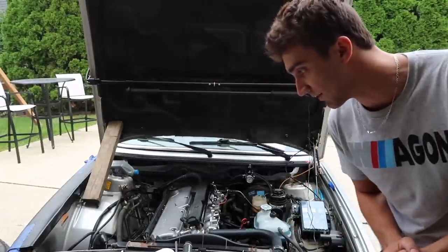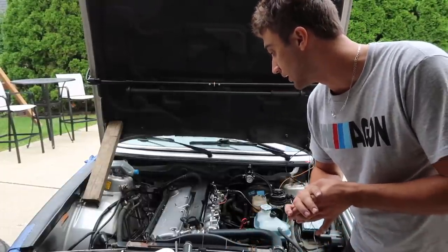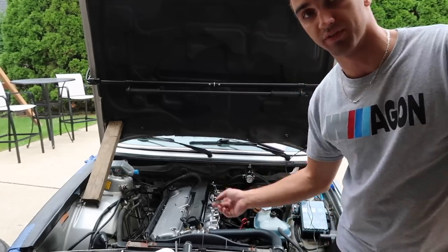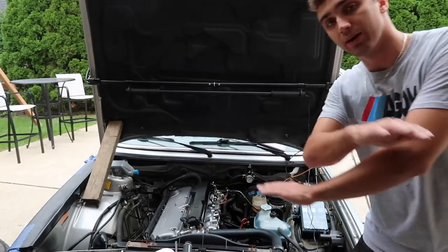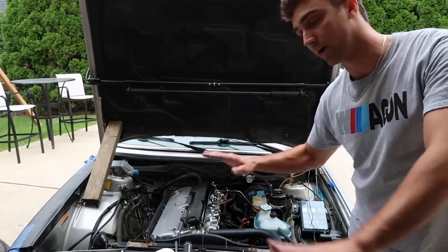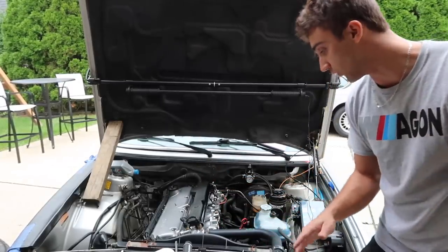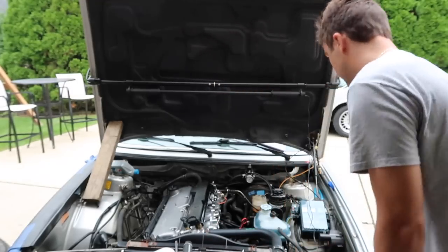Okay, that's 25 minutes, probably actually more like 27 or something. But I think we are good to go and pull this valve cover and retorque these head studs to the final stage, and then we are done with worrying about engine related stuff. Temperature stays nice and cold, no overheating, everything looks good. I'm actually gonna crack the bleeder for the one last time here.